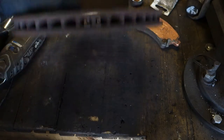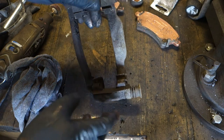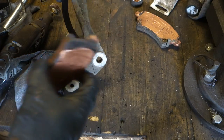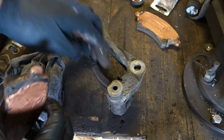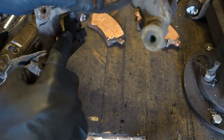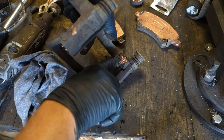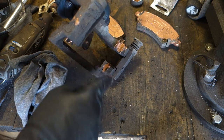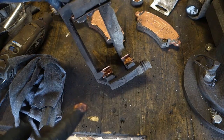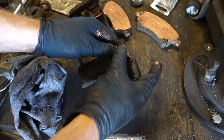And then we had this final step, when we had these brake pads holders, that we need to check that these parts work well, and we need to insert lubricant also in those areas in here. I will do that next, and I insert it also in here in that way. I insert this copper paste in this joint, and on the other side also all areas, and also in here a little bit more copper paste. And then when I have done that, I can guarantee that these parts move.